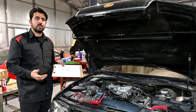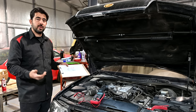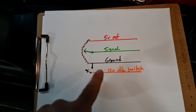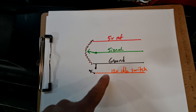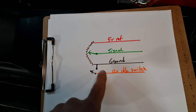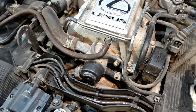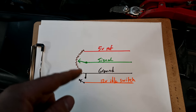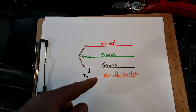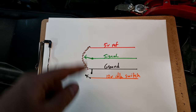Most throttle position sensors work with three wires, but this car has four wires going to the sensor. The fourth wire on this setup is for what Toyota calls the idle switch. This fourth wire basically has 12 volts coming from your car's computer. When the throttle plate is closed, this switch is also closed and it's grounded at your throttle position sensor, pulling that 12 volts down to zero so your car knows the throttle plate is closed and will activate your idle air control valve. When you step on the gas and open the throttle plate, the switch opens, the voltage goes back up to 12 volts, and that's how the computer knows the throttle plate just opened. If you have a three-wire throttle position sensor, you just need to worry about those three wires.